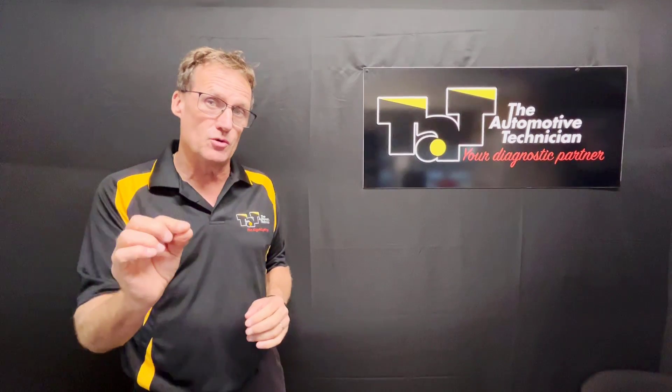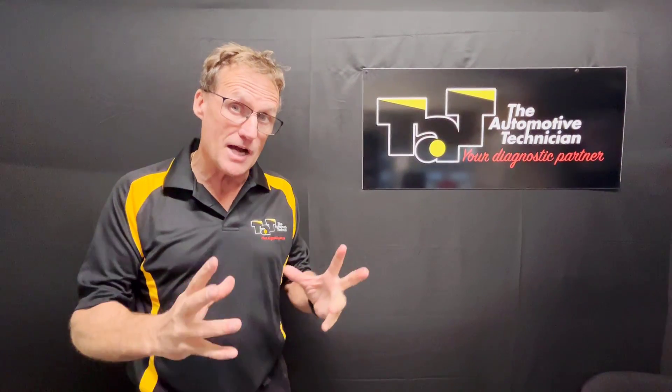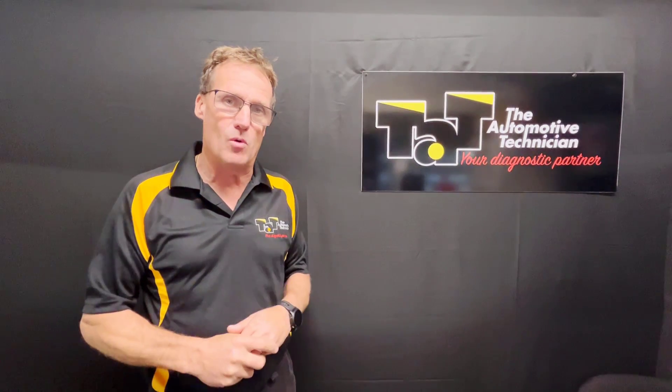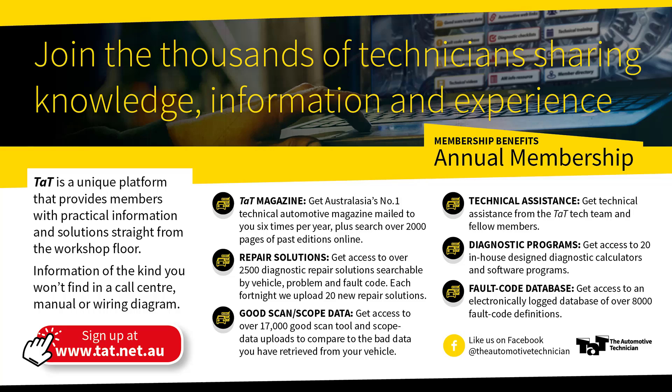Good news at the end of the day — the car got mobile again. It was the first time that car had driven for many, many months, with that replacement battery pack in there. A lot of good learning from that particular job, which we're going to get more and more of as we go forward. In the future, I think we'd get a four-volt lithium-ion battery charger, which you can buy from Jaycar etc., and we would put that battery on charge to get it up to a balanced four volts with the rest of the cells before putting it in next time. But in the end, the car's back up and running and that cell balance is coming back into where it should be. Hopefully you'll learn something from this. If you're a TAT member, keep in tune for what we've got planned in the future. See you next time.